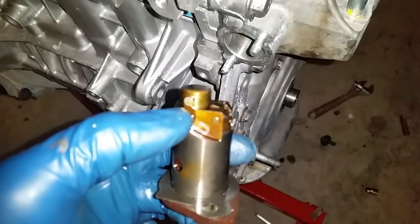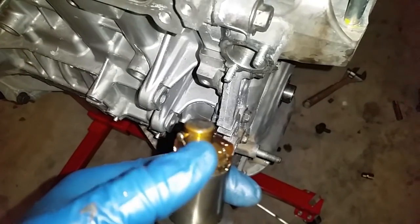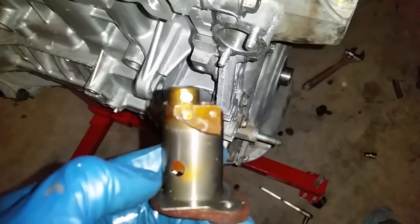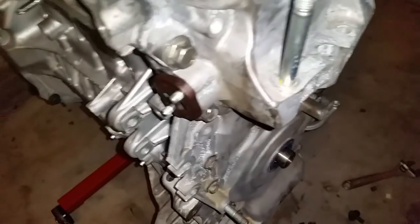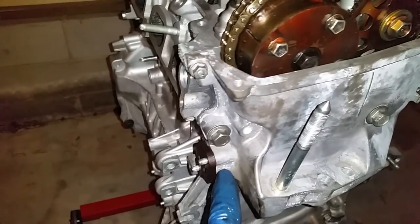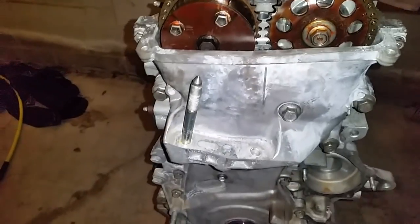There's a hook right here that you have to push down on the piston while unlocking the lever so it doesn't catch on the teeth, and then put your lock on the piston so it holds it in place, and you go ahead and insert it, line it up, and torque it. And then at that point you have to rotate the crank counterclockwise to apply pressure to the tensioner to unhook it from the hook, and it'll shoot back and give the tension required for the chain.